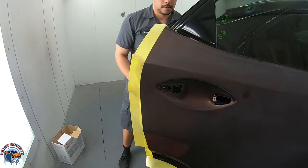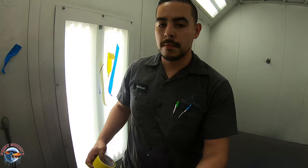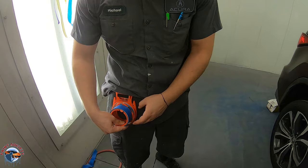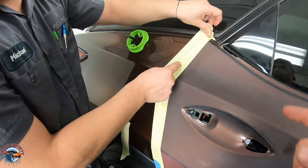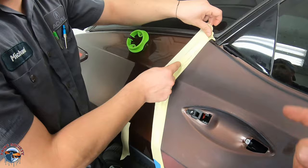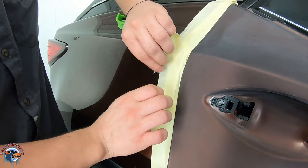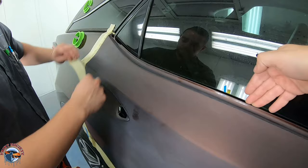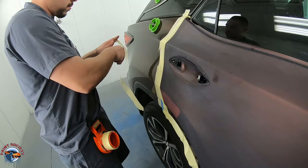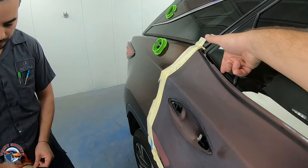When you go to unmask, start with the front door and do the reverse. On the bottom he's going to attach plastic to the tape, so the whole door is back masked and ready for paper. We're going to have him put the caddy on. Then he's going to pull the tape just a little bit toward the back — that's going to help keep that bridge away so when the clear coat goes it doesn't stick. Pull it nice and tight.